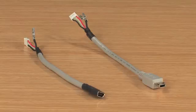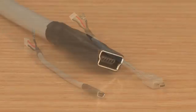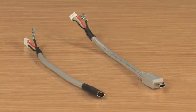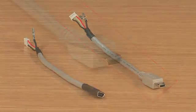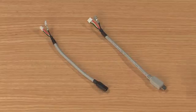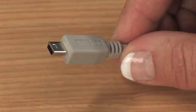If your printer has an external connector, you install the JetDirect USB cable with the wrapped end into the HIP. If your connector is embedded, you will install the JetDirect USB cable with the exposed metal on the end of the connector into the HIP. Now that you have determined which cable you need, you are ready to connect it to the JetDirect 2800W.